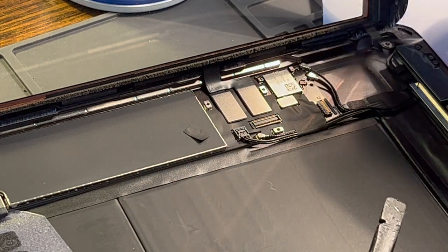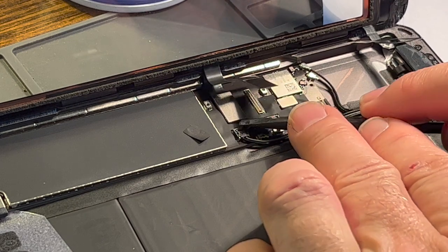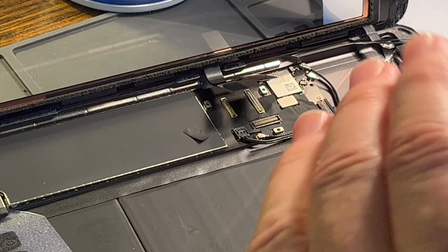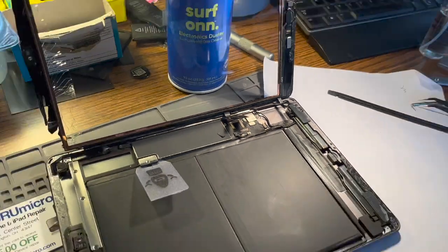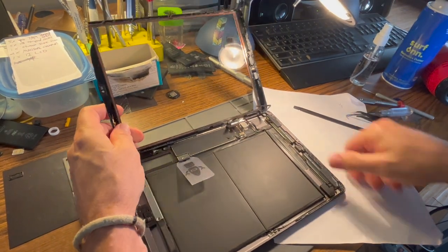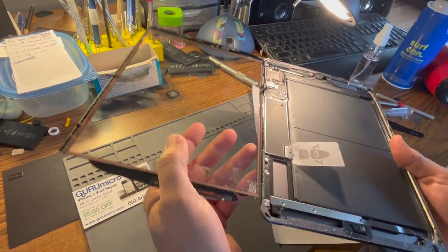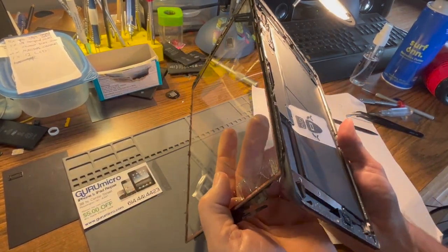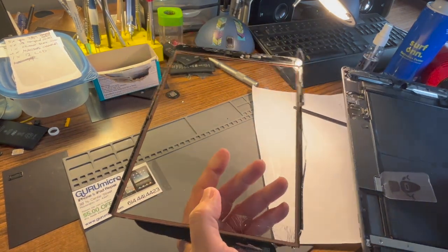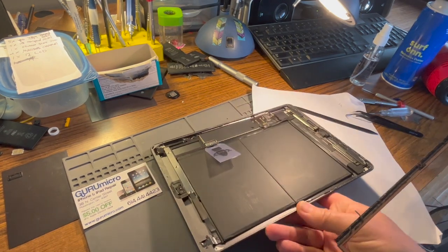Once you get that cable, now we're going to lift these two — similar, just under the edge, very slightly and just push up. This thing is now ready for finishing pulling the screen the rest of the way off. It is still stuck, so I just fold it — now everything's unhooked. I fold it all the way around to break that adhesive and then just give it a little pull. The screen is off.